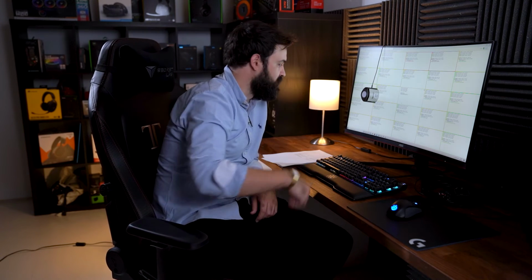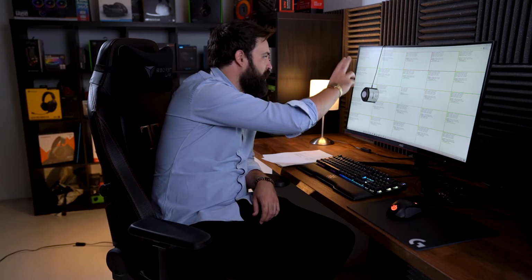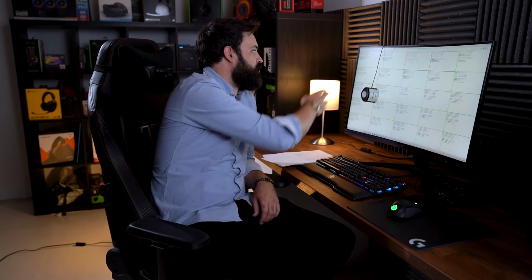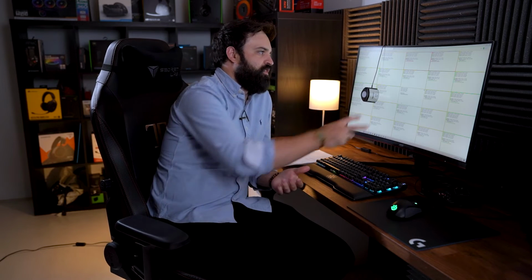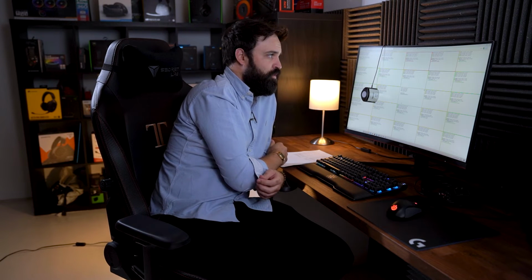Usually the corners are the worst on monitors, but as you can see from our results, they're actually not that bad. I mean, I'd expect more red, if I'm being completely honest, but there is no red on the corners at all. As you can see from our results, the two squares at the top were the worst. They've got an average deviation of around 5. The one on the left has got 5.49, the one on the right has got 4.7 maximum colour deviation.